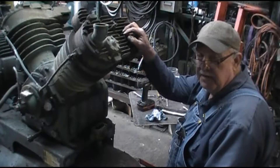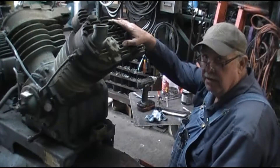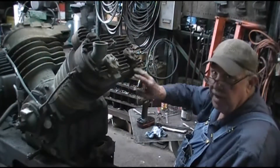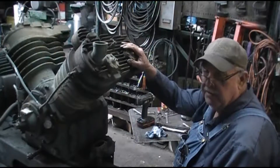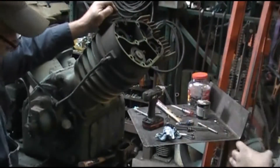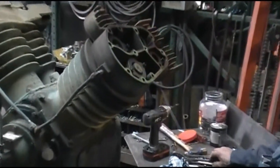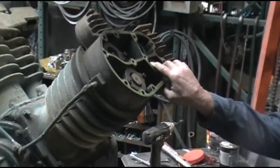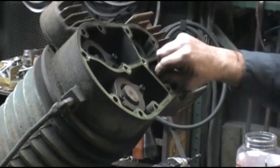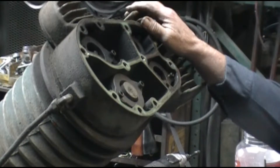At this point we've taken everything off that's in the way. Now we're going to inspect the valves — these are valve covers — to show that the valves are all intact and none of them came apart on both heads. After we get done with that, we're going to pull the head and show that nothing's dropped down on top of the pistons. It'll be very noticeable if something happened because there will be indications on top of the piston. Notice the hold-downs — all the bolts are in place, there's not a bolt missing. The valves are still intact, they're still tight on this head.